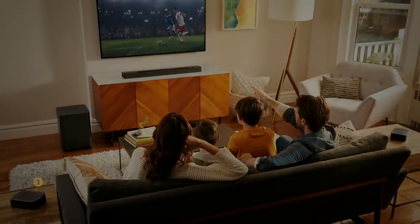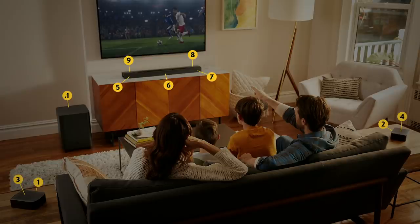Follow and do that again with the right speaker — pull it off, turn it 180 degrees so the rear surround speaker is firing back into the listening position and both Atmos speakers are firing up into the room. Those four speakers — surround left, surround right, Atmos rear left, and Atmos rear right — that's four channels. Plus your front three speakers: front left, center, and right makes seven. Then your front Atmos speakers on top of the bar — that's two more, making nine. Add your woofer, the 0.1. So this is a full 9.1 surround sound experience in one simple, easy-to-use package.